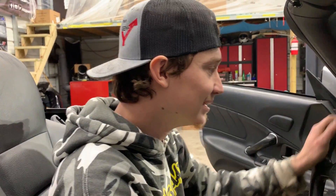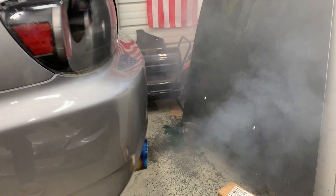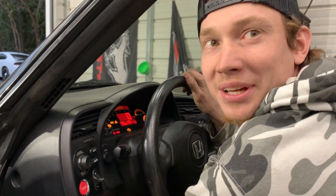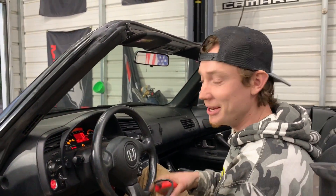She's purring! Hey, there's no smoke out the back - it runs perfect, so smooth. Let it warm up a little bit and then we're going to see VTEC. Oh no - same thing. It's probably just burning the old coolant that's still in there. We're going to let this thing idle, let it die down, try to clear the codes, check the oil one more time, and then we should be good to hit the road. We've also got to pump the brakes first - we ain't going anywhere without brakes.